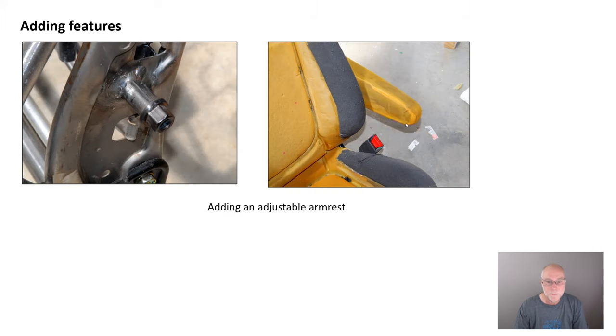There's another modification you can do as well: what about an adjustable armrest? I unwelded one from the original seat — just a seat I got from the car dismantlers — and welded a small extra stub onto this seat's frame. Then I could add the armrest. I picked the trim color of the donor seat so it was very close to the trim color of my seat, so I didn't even have to do any retrimming at all.